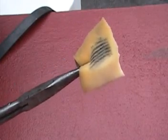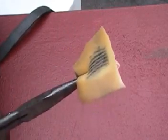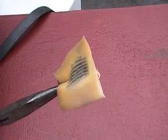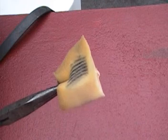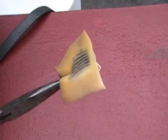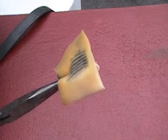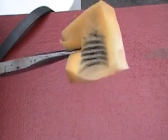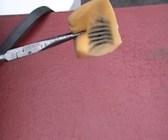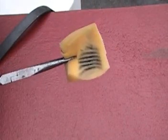At the same time, you don't want to hold on too tight to the pliers. If the belt grabs the foam, you should release the pliers so they fall to the ground instead of having the pliers pull your hand in. As long as the engine is running, you don't have a tie or scarf around your neck, and you're familiar with engines, you can dry clean your belt. If you're as lucky as I am, the squealing will go away for a couple of years. Try this before you spend any money.